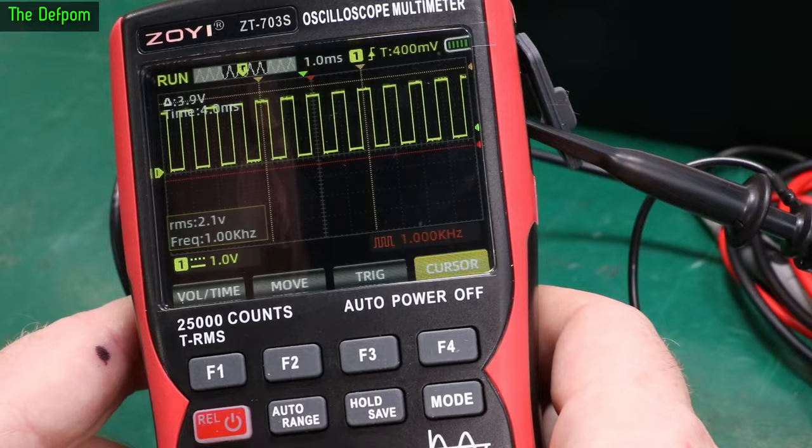While doing this testing, the screen kept going off — the unit stayed powered but the backlight went dark. Checking the settings, the backlight timeout had changed to 30 seconds on its own, which I didn't set. There's some kind of firmware corruption happening when using the external apps, causing settings to reset to defaults, including backlight brightness and timeout. That's a notable firmware issue for Zotec to fix.